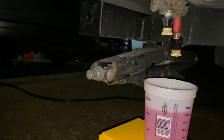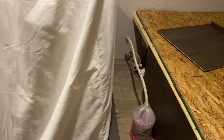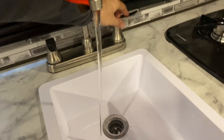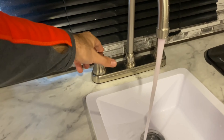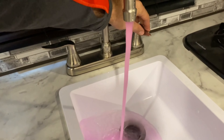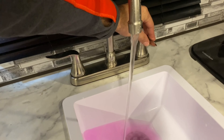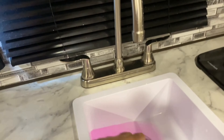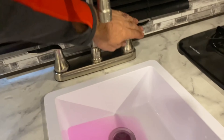Okay, we've got our low drains done. Those are capped off. We should be able to turn the water pump on and hear it stop after it gets pressurized. You heard that — it's pressurized. Now we're just going to open up the faucets. Okay, we're going to do the same thing with the toilet.